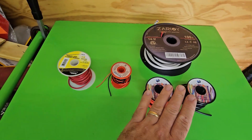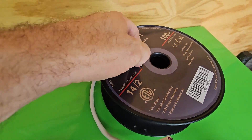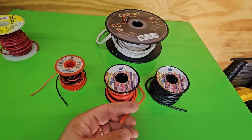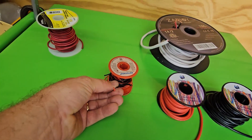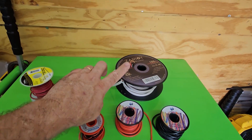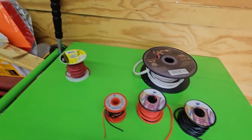When it comes to wire, you've got many options. You have wire in a sheathing — copper clad aluminum — which is cheaper and will work, but it's not the best choice. You also have regular automotive wire like Dorman. Then you have silicone solid copper wire, which is what I prefer. Make sure you pick the right gauge — we're using the heavier gauge because we're flowing current. This is silicone so it's really flexible and it's solid copper, so that's what we're going with today. I'll leave links to these down below so you guys can choose what you like.